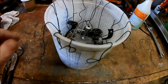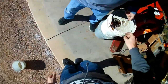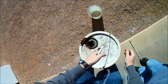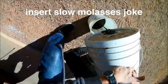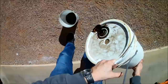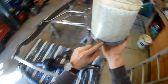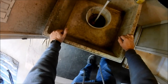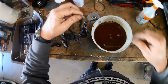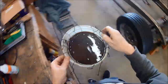This is the bucket I'll actually be dumping the molasses into, and this is where the parts will sit and soak. With the wire strung over the side I'll be able to pull the parts out and check on them periodically. As it turns out you can buy a giant five-gallon bucket of molasses on Amazon for about $25 — when you're talking about small parts like these, five gallons is pretty much a lifetime supply. We're going to be mixing water and molasses at a ratio of about 5 to 1, using an old paint mixing cup to help with ratios, though it's definitely not an exact science. Warm water will help the molasses mix, especially if it's a colder time of year. Once the mixture is adequately stirred you can begin to add your parts.